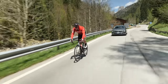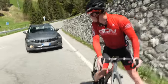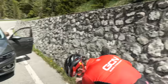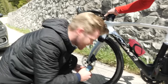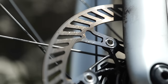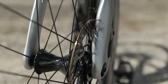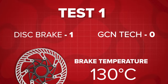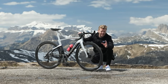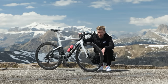16 minutes to descend. Let's pull over. Quick draw — get the quick draw out. 130 degrees. There is quite a bit of scorching on the rotor. You can also see a fair amount of brake dust from just one run of dragging the brakes the whole way — you can see it on the caliper. Test one was something of an anti-climax. We're going to up the ante — make Hank weigh considerably more with the weighted vest, and maybe a few other things, to really see if we can melt this rotor.